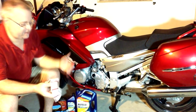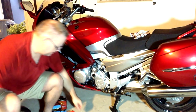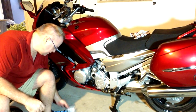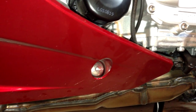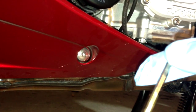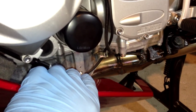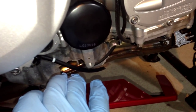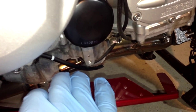First I'm going to drain the oil. I'll take the screw out and just bend the panel back. The previous gen bikes had a similar panel procedure but required two or three fasteners. With that fastener out, we can bend this out of the way. I'm going to wrap this in foil — now the oil can drip from that filter straight down. When I take that filter off, anything that drips down the side won't get on the paint and there's zero cleanup on the bike itself.